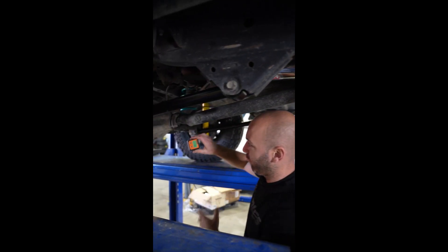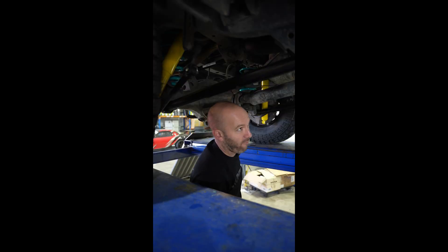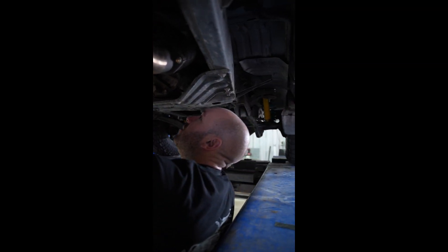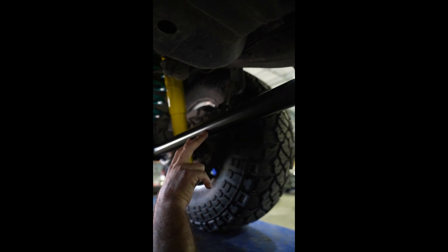The phone is probably what most guys have at home. If I have a brief look at this one, it's around 89 degrees, which is essentially one degree up from 90. And then if we go up to the output shaft angle, it's 88.5 degrees.